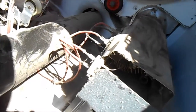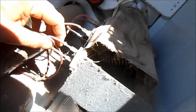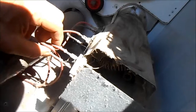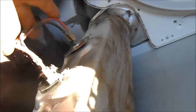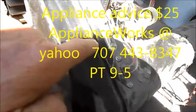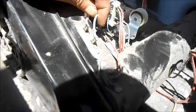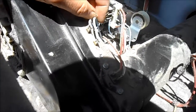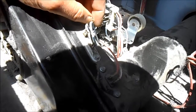Here's a little note about the heat element: if you run your meter between these two terminals you should show continuity - these are the terminals for the heat element. This is your high limit thermostat right here and this is your high limit cutoff. If either one of these are bad, your dryer is not going to heat. The thermal cutoff is normally related to poor flow - if your vent is kinked, all of a sudden your dryer doesn't come on or doesn't heat.